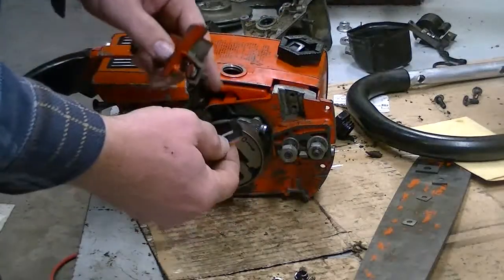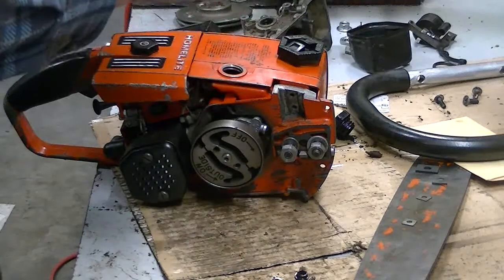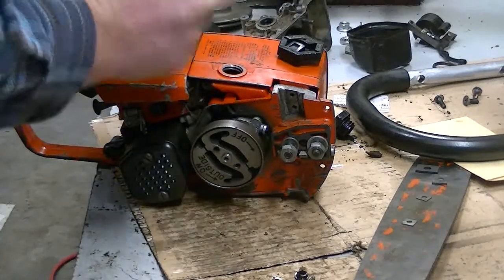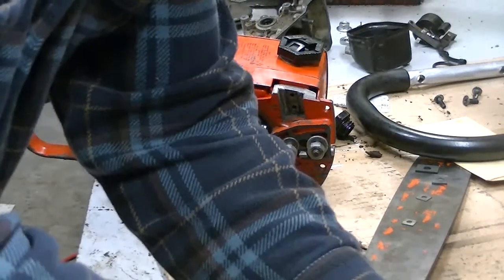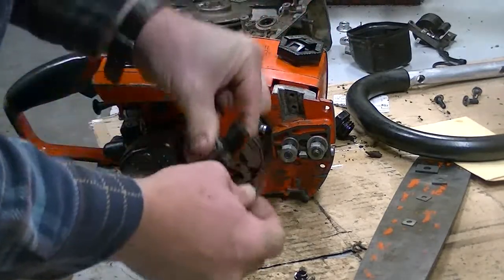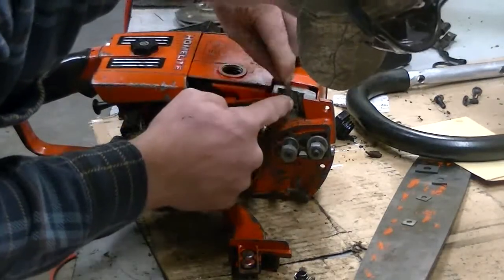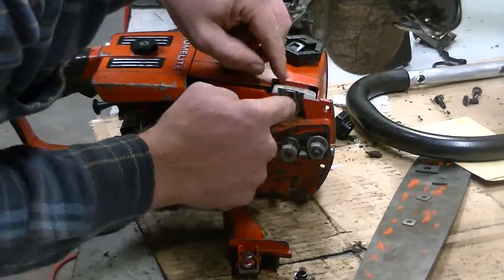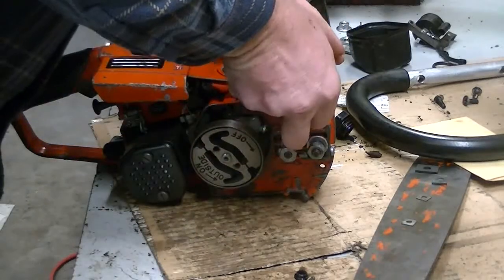And behind that, you have another molded rubber piece. Again, this is still very widely available. I've got a ton of them in stock myself. Fits right over the handlebar bracket. Then you've got your steel plate that acts as a stop for these screws. Now as this tightens down, everything compresses and it leaves just a little tiny bit of wiggle room. And make sure you get this bracket aligned with the cut edge facing the way it should. It's very obvious because you've got your fuel tank shape here.